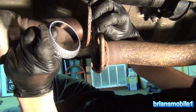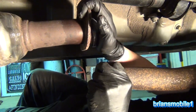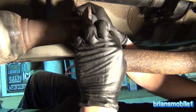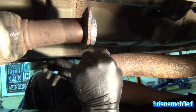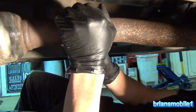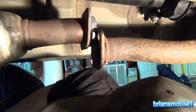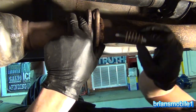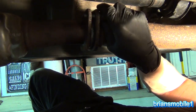The way you put these on is to put it onto the pipe first — give it a good squeeze and knock it on. That's why it's important to get the old one off first, otherwise it's a real pain to get these on. I've got that nicely pressed on. Lift this up to it — it's on a hanger so it'll swing forward and backward. I'll lift the back pipe into place and take the new bolts — they're five bucks each and probably worth it since it's hard to make new ones.